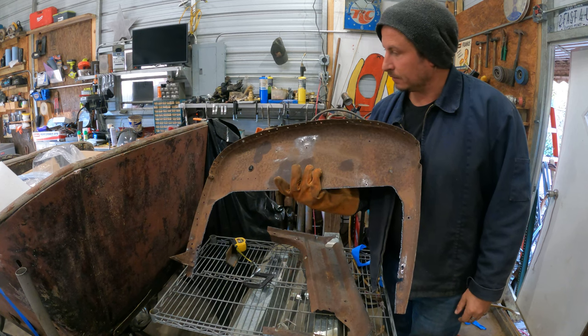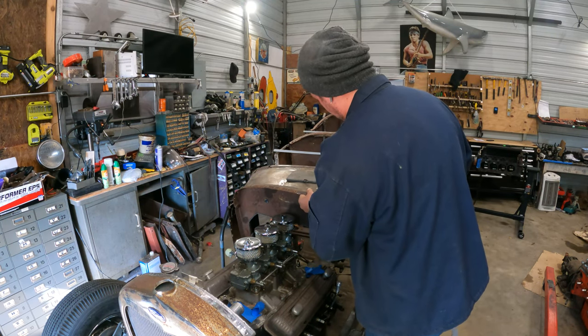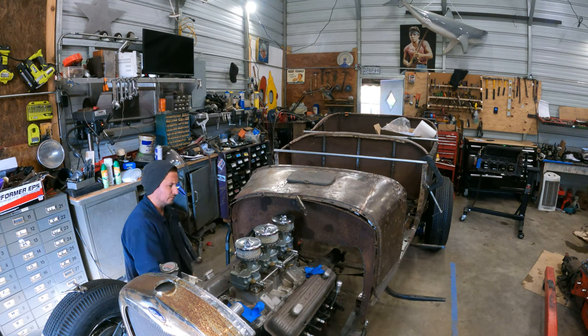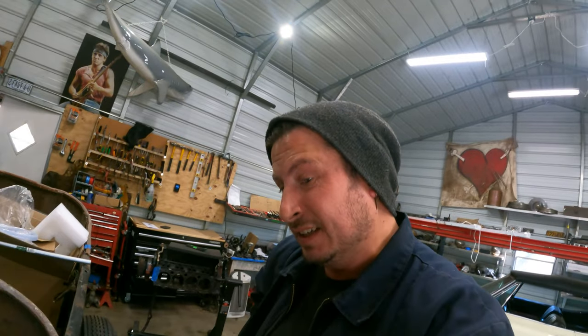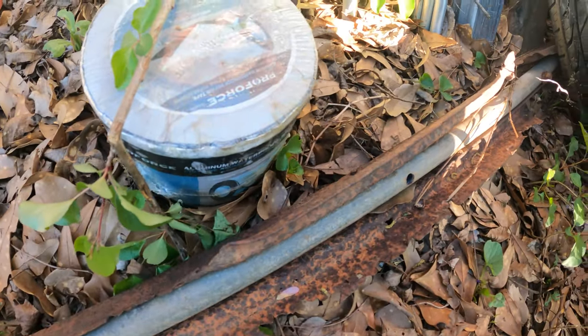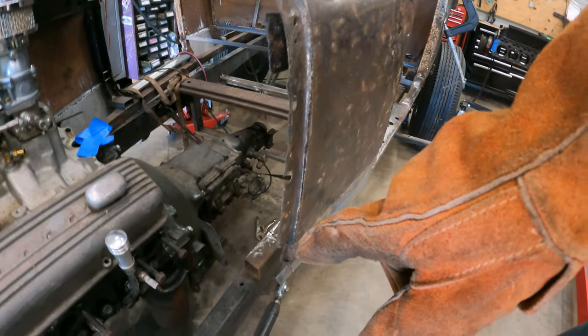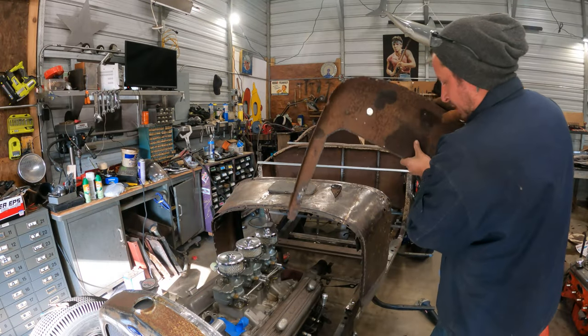Well, that's a hell of a thing. I'm very curious how different these shapes are — the cowl and the firewall — want to put them around. Everything I did before I realized I was going to have to do this is in the way, so let's get to hacking some stuff up that I super booger-welded in, and it's going to be no fun to remove. The original sub rail bolted to a piece of galvanized — I've got to trim the nubs of the sub rails I built to replace that trash. Those were ultimately a guess anyway, but I did build them right to the back of the firewall. Now that we're recessing the firewall, I've got to take about an inch off both sides, which is inconvenient. All right, round two gang — shorten the sub rails.